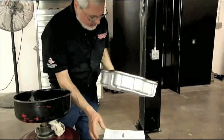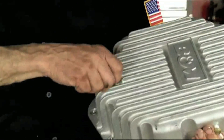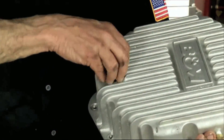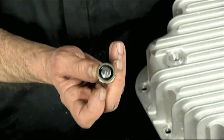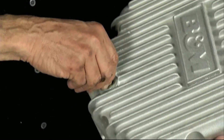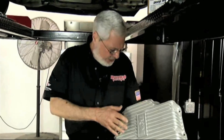We're ready — following the instructions again — to put on our oil pan. It's a beautiful cast pan. It has a nice big drain plug in it, and the drain plug has a couple of features: a washer with an O-ring seal on it, and it's magnetic. That little magnetic tip picks up any of the metal filings and helps keep them in place so they don't work their way back through the transmission.